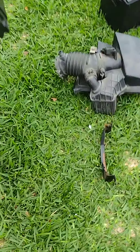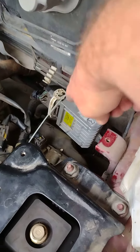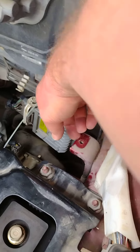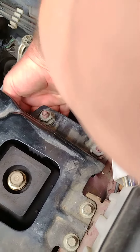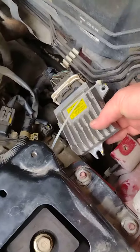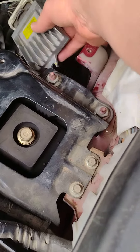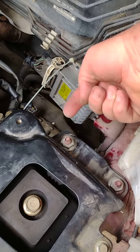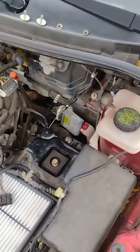As you can see, I've already mounted the TCM so that it's dangling off the line so that it's not going to be in direct heat from the transmission as it normally would. Here, floating around, it should get much better airflow. Originally this unit tucked in under this bracket, and there are three bolts that hold the TCM in place — as you can see the TCM has three mounting holes. To remove it, disconnect the connector here, which plugs in pointing in this direction, and remove the three fasteners and it comes out. That's basically how you get to the TCM on these cars.